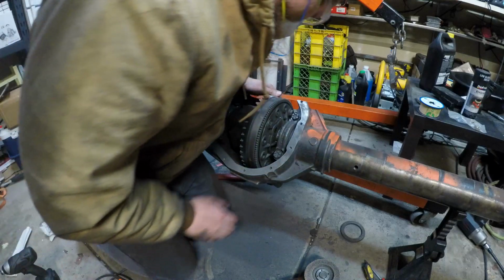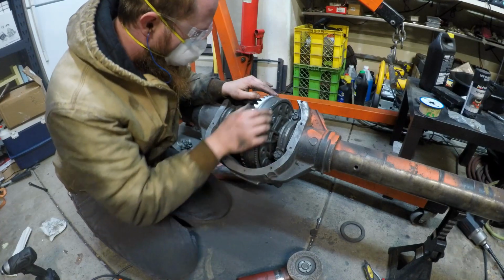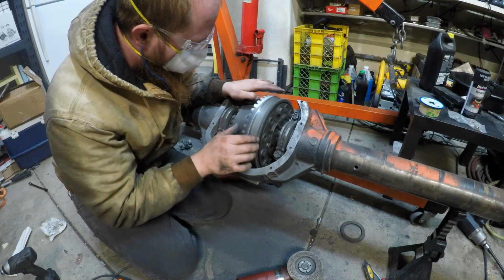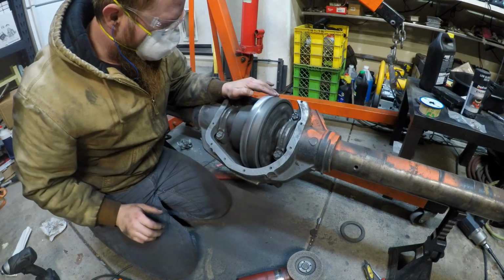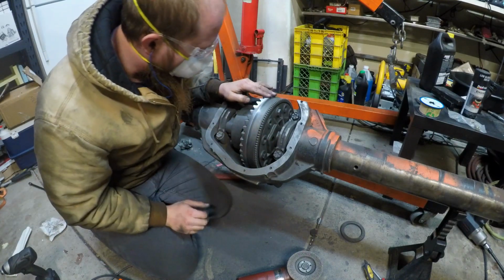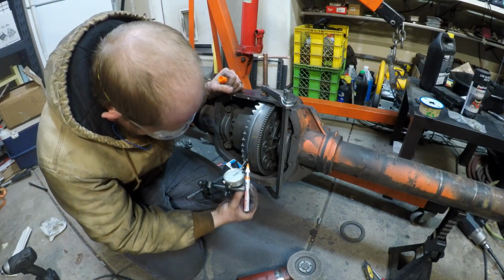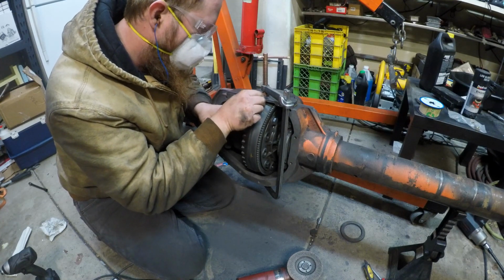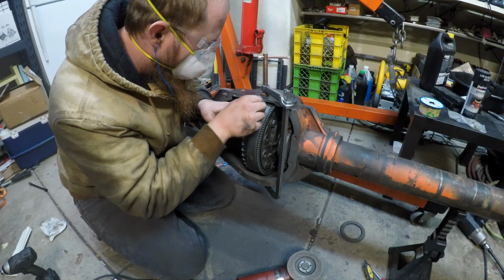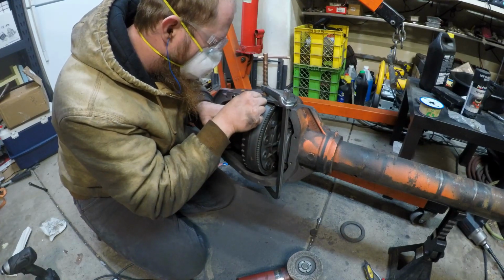And trying to use the very end of the flat disc where it's the fastest. See if that could change, because I've been riding on the backside, on the inner diameter. Seeing if that'll change where my whoops are and flatten my teeth a bit, because they were rounded. And yeah, that worked exquisitely well. Right there, right there. The teeth have now gotten a tiny bit looser than the outer bit. Cool. That is sort of what we were aiming for.